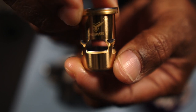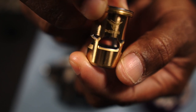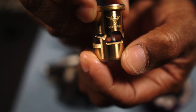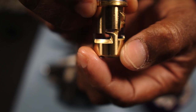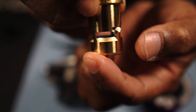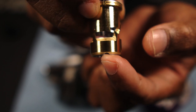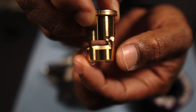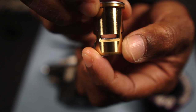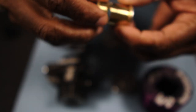Here we are at the exhaust side with some cuts. You can see it has the Novi stamp at the top of the exhaust port. This is a three port, but it's a three port with some nice cuts. Back on the other side — boost ports. You have to see what those cuts are about, but she's cut up pretty good. Back on the intake side — chrome plating on top. Looks good.